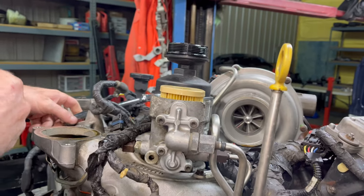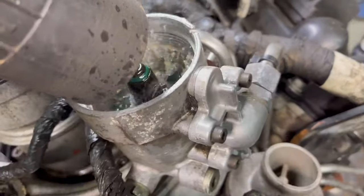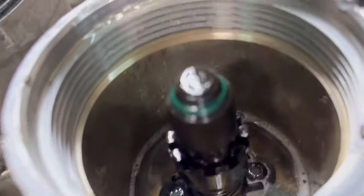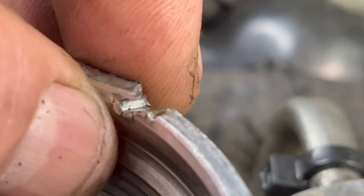New filter though — that's good to see. Should we bag that and reuse it? I'm kind of concerned with the fuel quality. See how inside of there it's discolored? That means rust. All you needed to do was just deburr that a little bit and it might have been fine, but that didn't even have a chance. This was another leak right here.